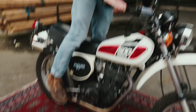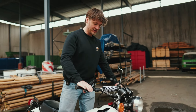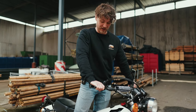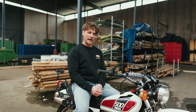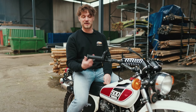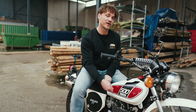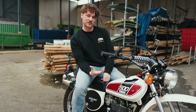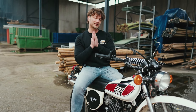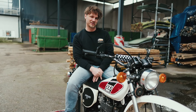The kickstarter of this machine is what gave our business the name Kickback. It's a love-hate relationship between you and the machine. The XT500 has a built-in kickback protector — a half-moon plate inside the engine — but it often breaks off. It can shoot out of your crankcase, causing a hole, or fall all the way down into the sump filter. This machine can fire back, so please start it properly and don't use the throttle — we have a starting video for that.